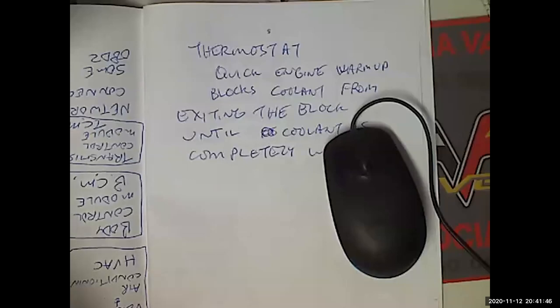Okay, inspect for leakage at external seals, gaskets, and bushings. Now, I made the point two weeks ago that one of the problems people have is that there's a shaft and there's a seal and the seal's leaking and people say, well, I'll just replace the seal. Problem is, every shaft is going to have bearings or bushings that are going to locate it and support it. And if the bushing and bearing have lost their ability to locate the shaft, you put a new seal on it, it's just going to start to leak. So look behind every seal and see if there isn't a bushing or bearing that needs to be replaced. That can be very frustrating on stuff like axle seals, because you put in all new brakes and then 3,000 miles later, they're all soaked with axle oil again.